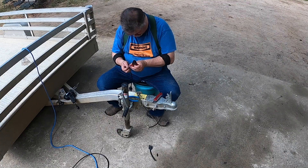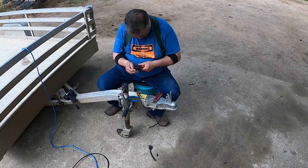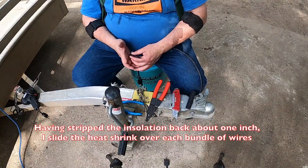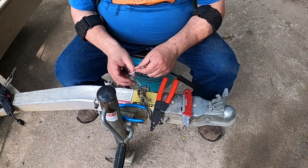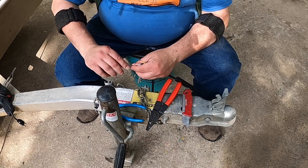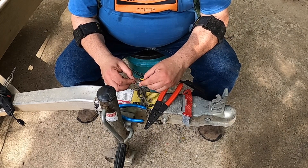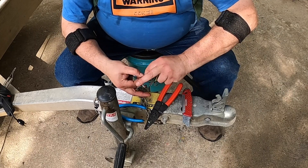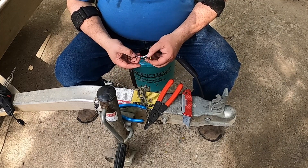Stripping about an inch of wire. This is also a common form of doing wires in aviation. This lineman's style is designed for holding wires that are going to be under tension. What you do is you come in here and make an L, then make a U-turn, tighten this up a little bit, make another U-turn, come in, hit these things, and then just twist them together. And this is the lineman's style of doing this — it makes a nice, tight connection.